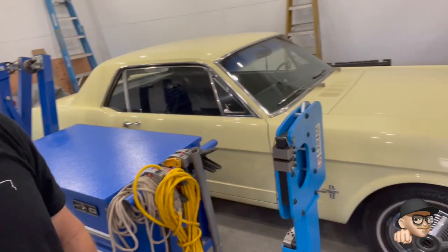The Brazilian metal they used was a slightly thinner gauge — a proper 22 gauge — whereas the German metal was one millimeter, so they're close but not the same. When you're welding it, it's better to have them a little bit thicker than thinner. So this week my job is to find a fender, a couple donor parts, start cutting off some metal and banging it into place. I got this little guy here — my shrinker/stretcher — I've got some shrinking and stretching to do around the windows.